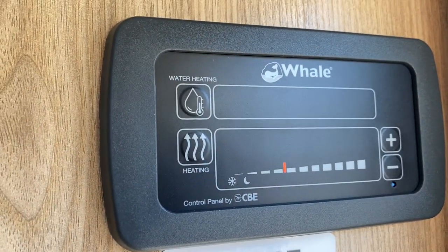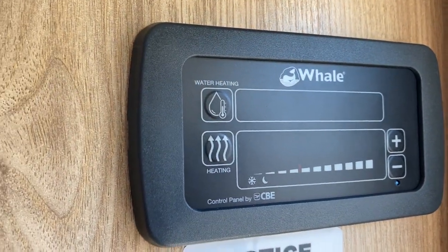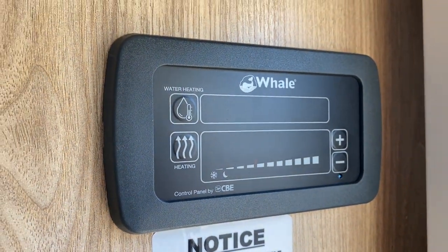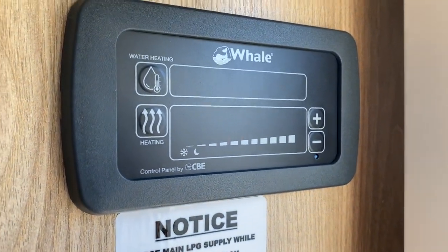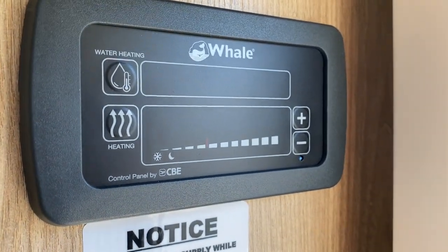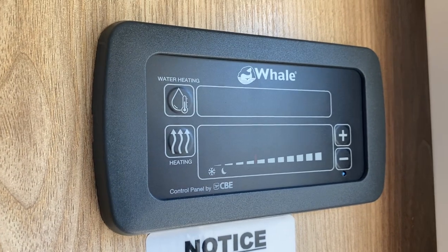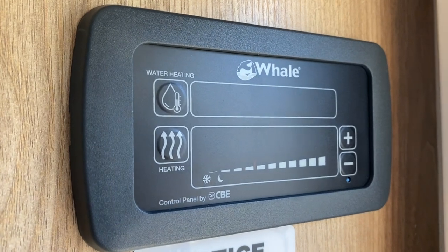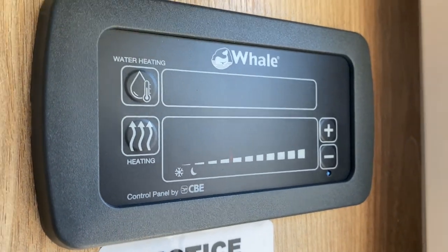The little plus and minus button is the power of the fan, so you may initially want to turn it right up to give a powerful surge of heating. It will take probably around 20 minutes to warm up on electric. The best way to use the heating system is to run it on gas and electric initially to get up the temperature, and then pop it back onto electric to maintain. Same for hot water — gas and electric to start, then knock it back onto electric. If you're not on a site, it would just work off gas. On gas, expect it to take around five to ten minutes to heat up, and hot water also five to ten minutes on gas. It's a much more powerful way of heating.